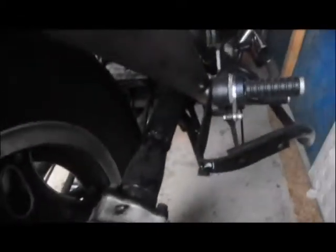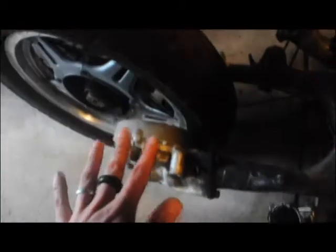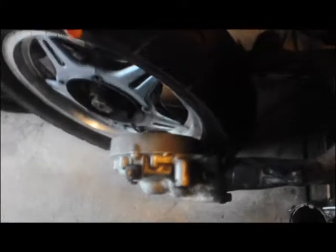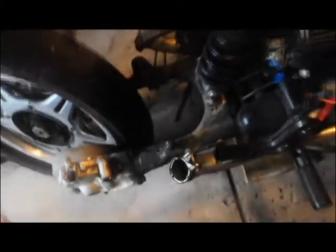There is a little bit of slop in it, but I'm going to make it exactly 7 inches, no matter what. All you gotta do is put the wheel back on so that this thing and the other side are lined up perfect, make sure the wheel is square and level, and then you can just weld it right back on. It worked before. I'm gonna try it again, and this time I've even got a better chunk of pipe.